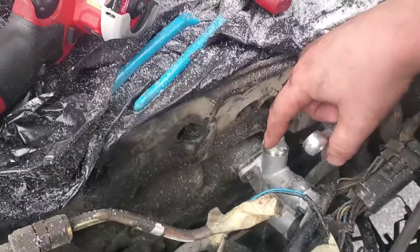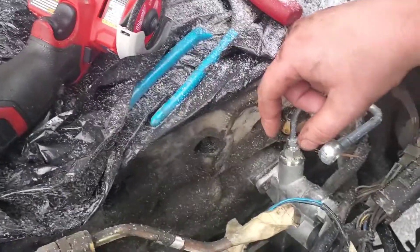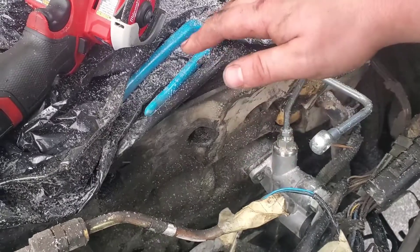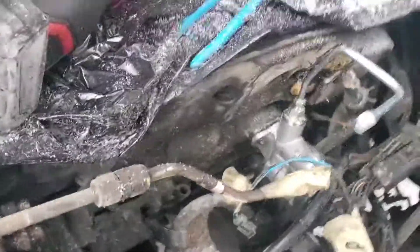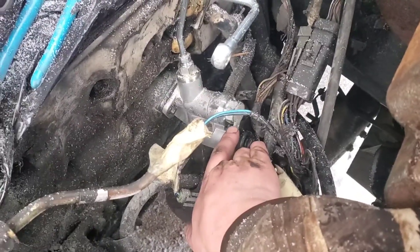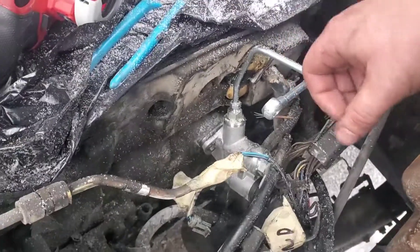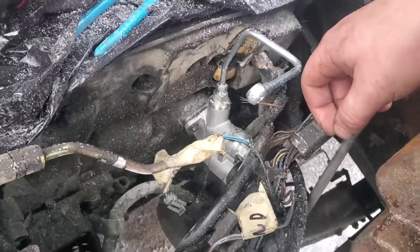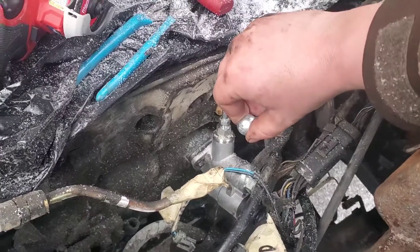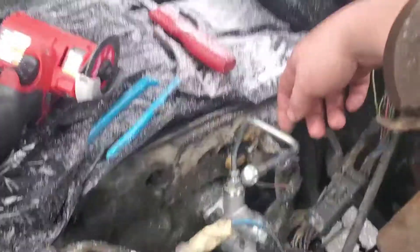When I put this on, I put a thin smear of RTV on the gaskets — a very thin amount — and that worked fine. I also put a really small bit of blue Loctite on the bolts. Here's our fuel inlet, and we'll mess with that getting it set up. I'm having a real hard time getting the fitting off the old pump. I was hoping to save it as a spare, but I think I dicked it trying to get the thing off.